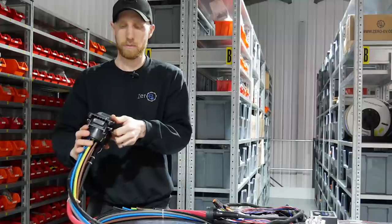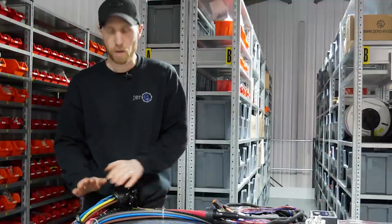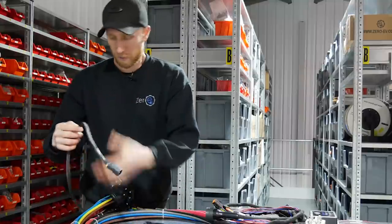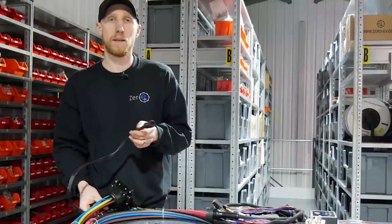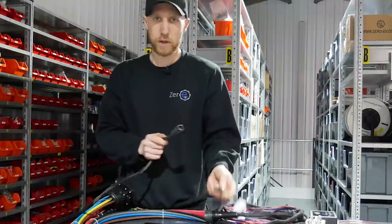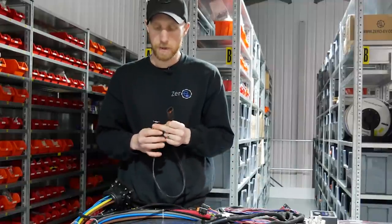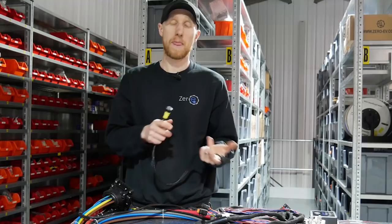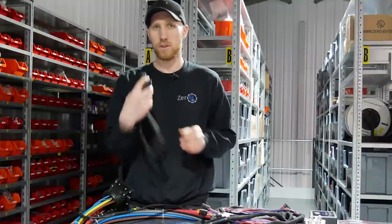On the CCS socket itself, you get two caps you can remove. The AC cables come out to go to your standard AC charger — these are three-phase, though you might be running a single-phase charger which is down to preference. There's a control pilot connector and temperature sensors that continuously check the temperature of the DC charging lines; if they overheat it will limit back or shut down. The start/stop LED is an RGB LED and also a button — it shows blue, white, green, or red to indicate the charging state.